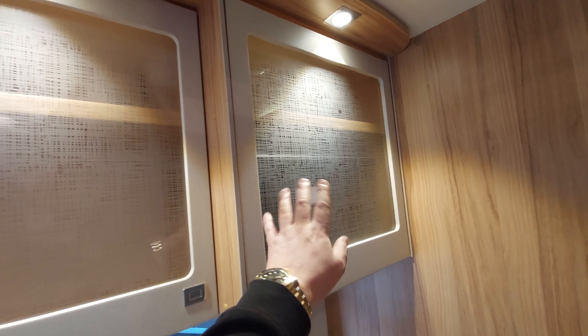The fresh water tank is just here. Draining the fresh water is vitally important — don't leave water in the motor home for any length of time; whenever you're not using it, drain it down. Certainly in cold weather make sure the water is out. If you overfill your tank it's going to go past this tube here and flow into the motor home, so it's important to keep an eye on the control panel percentage when filling. To drain the water tank, this bung here goes into that hole. Make sure this goes back on tight so the pressure of the water as it's being filled doesn't come past the seal and flow into the vehicle.